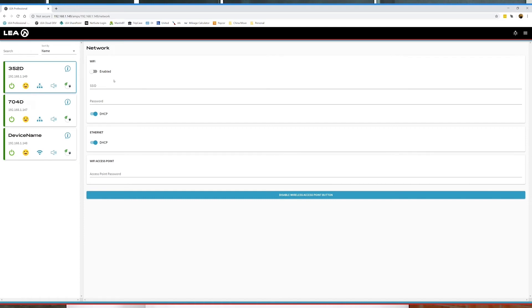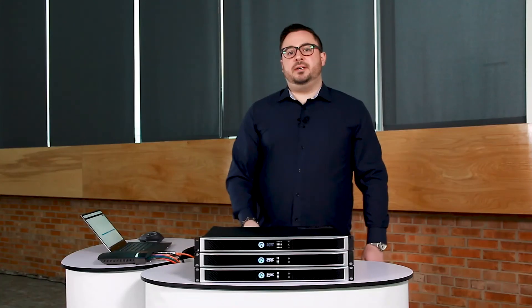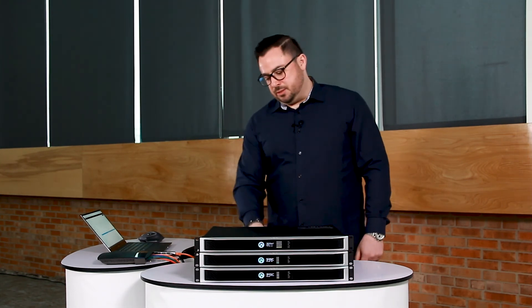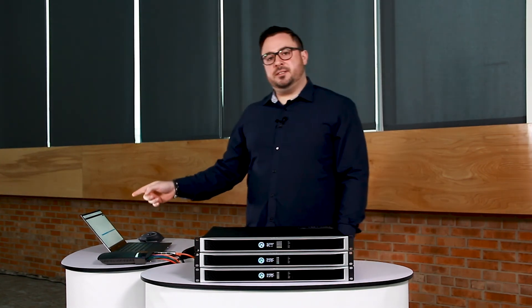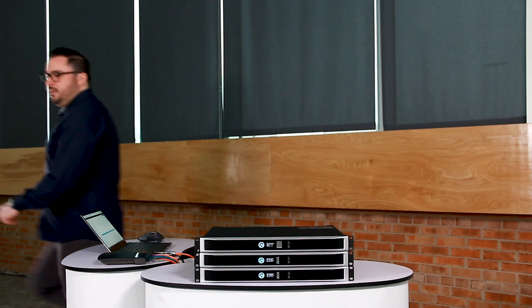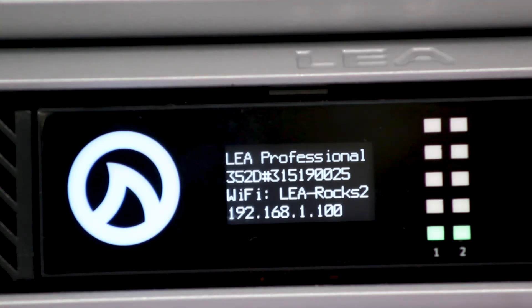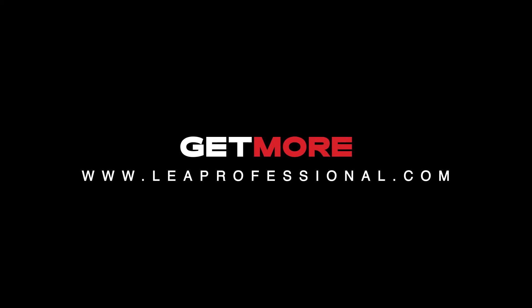So now we've got 149, which is here. So we'll go into this network configuration button. Now you can see the fields to change the Wi-Fi, just like we did on the previous one. So we're going to enable the Wi-Fi, type in the same LEA-ROCKS24G password, and we are going to click the save button. So once it's in wired mode, you can either be in wired mode or Wi-Fi mode. You see the green light kind of shifted the second we hit save — so we don't need to press the button like we did while we were in AP mode. Coming around to the front, we should see the SSID is here, it's connected, it's got an IP address, and we are all good to go and connected via Wi-Fi.